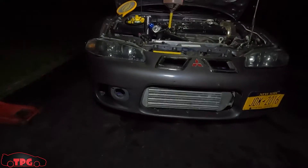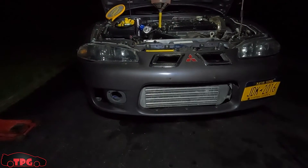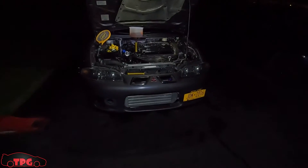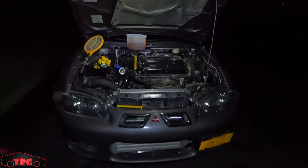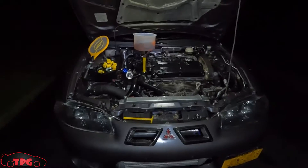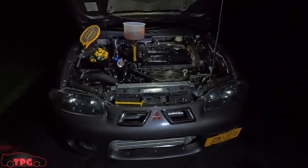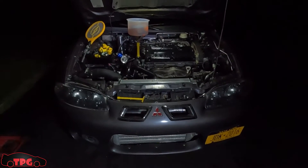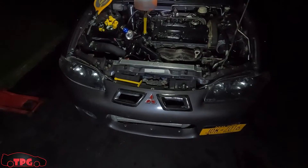I think we're all set up. I will keep you all posted on if I see any changes. Right now I'm getting between 186 and 193 maximum on a hot day, with 203 on the highway with the AC running. We'll do tests with the AC on and off and I'll post results ASAP so you can decide if you want to try something like this for your 2G if you're having cooling issues. I'm super excited to see what the fan shroud does — I think it's going to improve things. We're also going to keep a close eye on that little piece of metal underneath to make sure it catches air, doesn't have any issues, and doesn't bend.